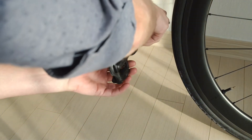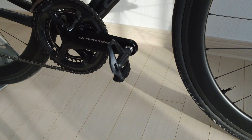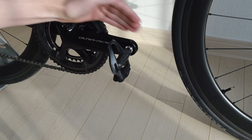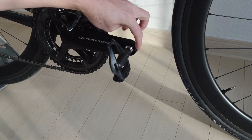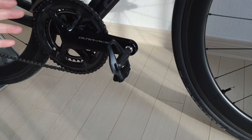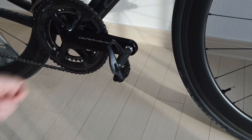You can just put an Allen key in the back and do it very quickly. There we are, that's done — obviously you'd want to give it a bit more of a tighten. We are tightening toward the end of the crank arm. Once you remember that you tighten it clockwise and towards the end of the crank arm, you'll always remember how to take it off as well.